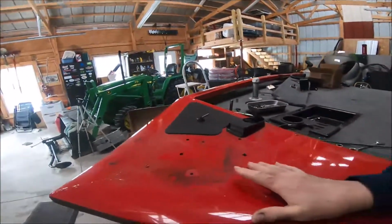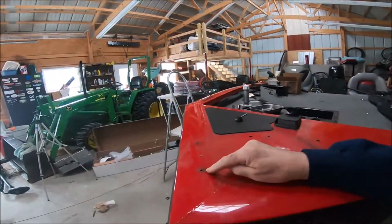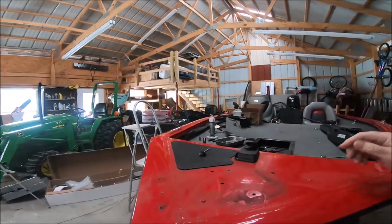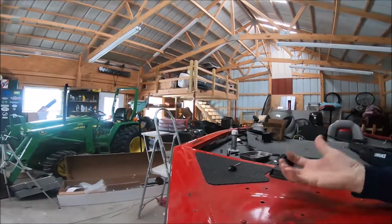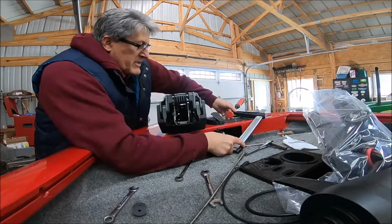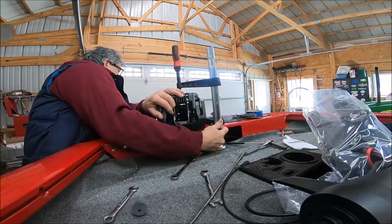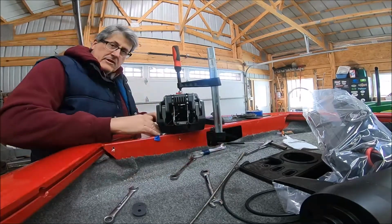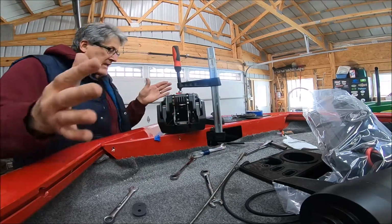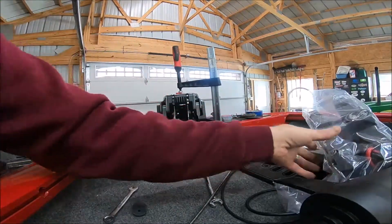I took off the XI5, and this is an aluminum channel, about 1/8 inch. And on the XI, I had to use sheet metal screws because you can't get a nut on the back. I don't want to do that with the Ghost. This is heavy gauge aluminum, and there's probably either a 1/2 inch marine plywood underneath. It's just me, so I need a little help so this thing doesn't come tipping on me. I have tape in here which marks my angle this way so it doesn't protrude off the side of the boat. Now I got to get a front to back position, and this son of a gun is heavy. So if you get some help with this, get it, believe me.